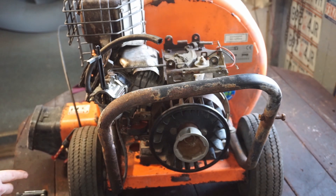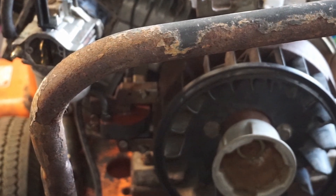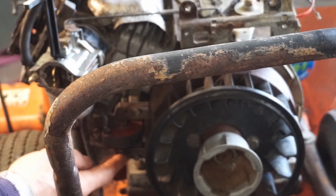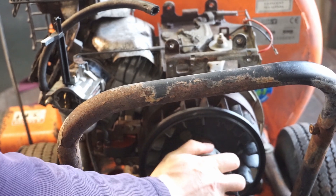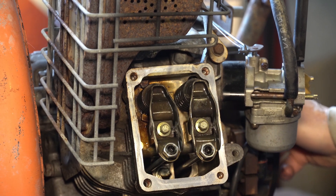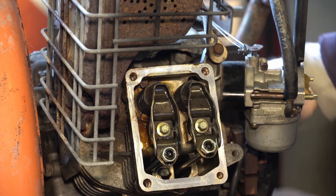The magnet is right here straddling the armature on the coil. I've already gone over the valve events so I already know I'm at TDC, so I'll start from here - both valves are closed. Now let's rotate it clockwise - you can see the cupping on the flywheel. The first thing you're going to see is an exhaust valve, because it's already fired so we want to get rid of the gases. That's the exhaust valve - there it went. Now we're going to suck fresh air in - air and fuel mix - there it goes.